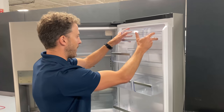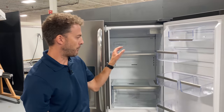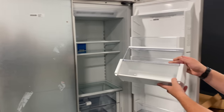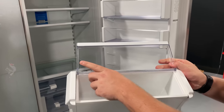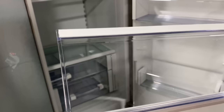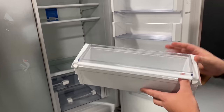There's a blue hue to that Lexan plastic, and when you compare it to the green hue of the glass there's a little bit of a color mismatch. On the Sub-Zero, the plastic has a clearer look and you don't see as much blue coloring. They have white closeouts on the edge, smaller ejector pins, and what appear to be two edge gates. Underneath the metal edge piece there are likely others, but overall it's a much cleaner look on the Sub-Zero.